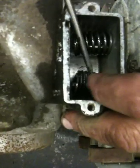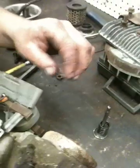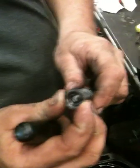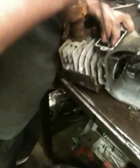This is also one of the difficult parts of getting the engine apart. Usually you shouldn't need to do that, but basically there's your intake valve in this situation. That's your intake one. There's your intake return spring and an intake retaining clip. Basically what you're doing in there with the screwdriver is it's hooked like that and it's under spring pressure. So what you got to do is get it to slide the valve over and then it will release. Your exhaust valve is exactly the same thing.